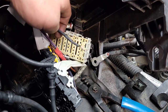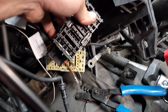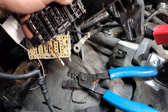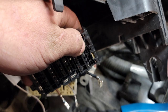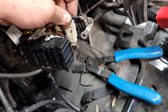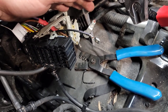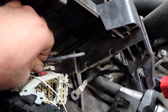Now we've got one more wire we've got to take care of. Going here, see the dovetail on the bottom again by my pinky. Come up to this second cavity which I think is pin 47. In the back, release a little tab right here — there's a violet and black wire. You're going to cut the end off of that, heat shrink it, dead-end it, fold it over inside the harness, and tape it to the harness.